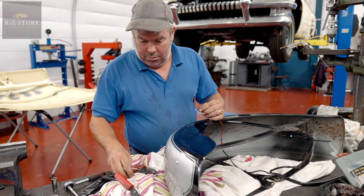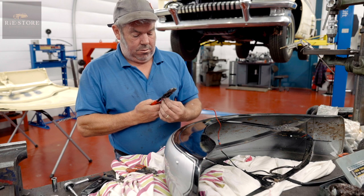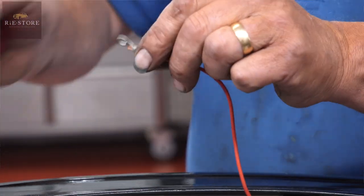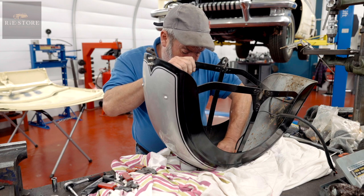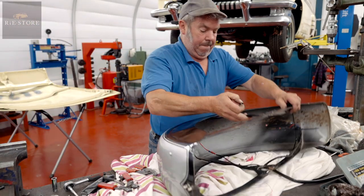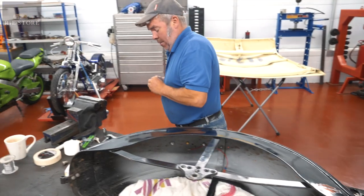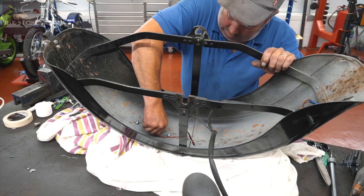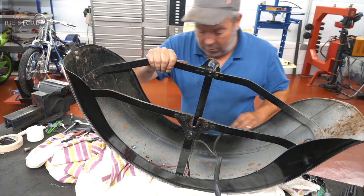Jimmy Knuckles. It was them, was it? Yeah. Okay. Right, looks like an M5. Let's find a little bolt for that. Make sure it is an M5. M4, I think. Well, unless they've done it imperial thread, but I doubt it very much, being a repro part. Blimey. It's not metric. Alright, we'll leave that for a minute because that's going to be me searching for crap everywhere.